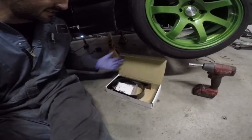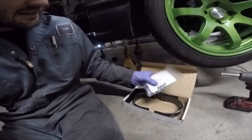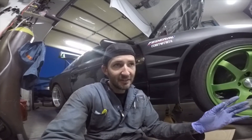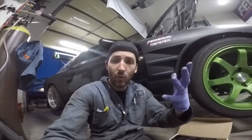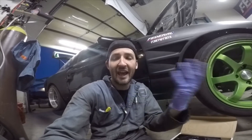This is the kit we ordered from Summit Racing to do the drive shaft hoops. It comes in a simple box with two hoops, two L-brackets, and a bunch of hardware. We're going to put it up underneath and see how it fits — they never fit properly the first time, you always have to cut and modify them. We also have to be about six inches back from the main carrier; we use a paint pen to mark that.